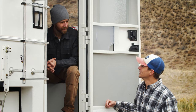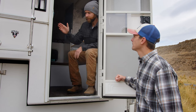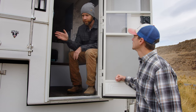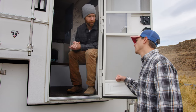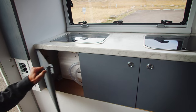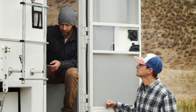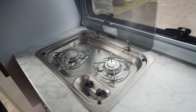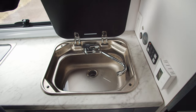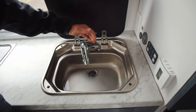Let's go inside — give us the 360. Going left to right: there's an air furnace, a 12,000 BTU propane furnace that'll heat this thing up within a couple minutes. Below that is a water heater, right next to it under the kitchen counter. Above that is a two-burner propane stove with a flip-down lid that allows it to serve as counter space when not in use. Next to that is a Dometic sink with a lid — also doubles as counter space.